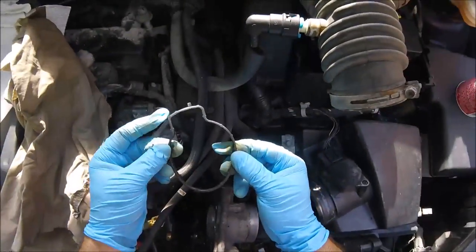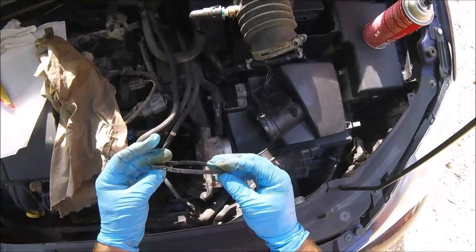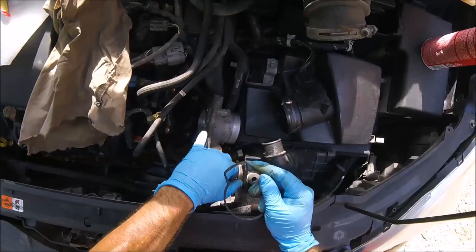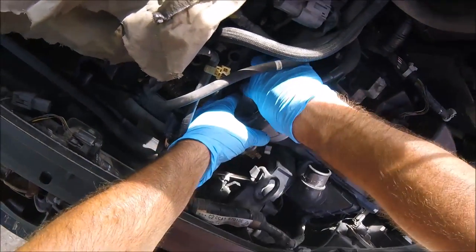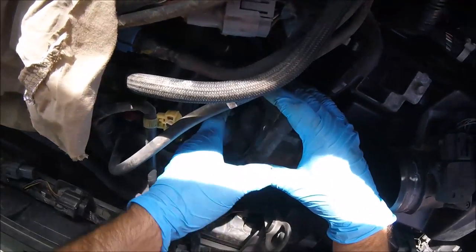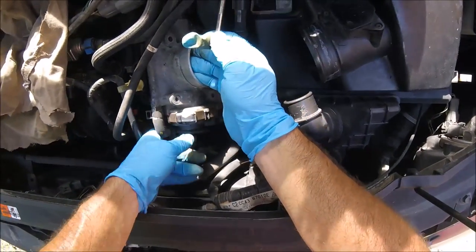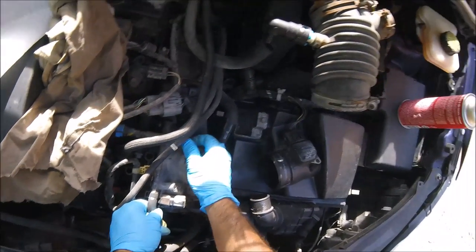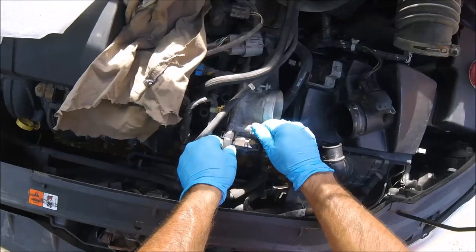The gasket I cleaned inside with just soap and water, making sure it was clean and had no little tears — it looks pretty good. There are two little placement spacers that go right in this spot — fit those spacers in and work around to make sure they sit in the little grooves. Now back with the bolts, cleaned up. Set the throttle body back where it goes, always finger tight first to make sure the threads are right. Get a couple of the easy ones started first.